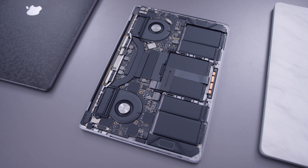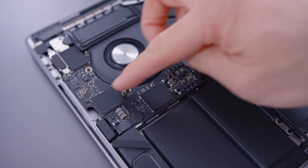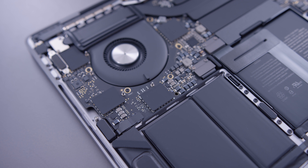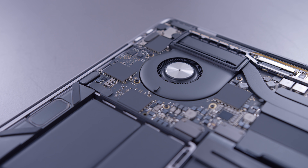The other thing that comes from having such a thin device is that you can't have removable components inside. The RAM being soldered on isn't anything new — Apple's been doing it for years and other Windows laptops have too. But having soldered-on storage is such an inconvenience. You can't ever upgrade your storage, and if anything goes wrong, you have to send the whole device back to get it fixed. It's seriously unnecessary — all to shave one or two millimeters off the device? It doesn't feel like it was worth it.